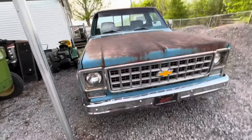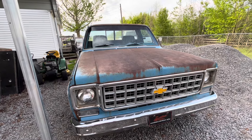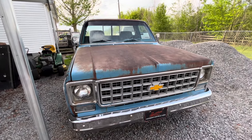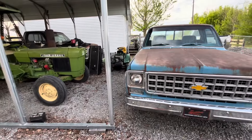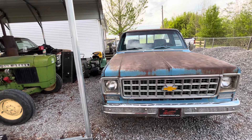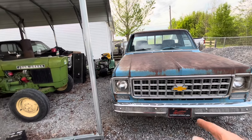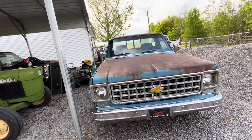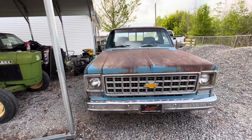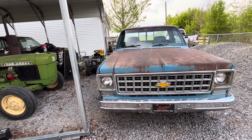It's been a while since we talked about Short Bed Fred. For Christmas my wife got me some roller-tip rocker arms. I put them on, it didn't run right, drove around trying to work out the problem, ended up putting the old rocker arms back on. When I tightened the number four rocker arm down and it made contact with the top of the valve, it started popping back through the air cleaner. Long story short, had a bad valve in the head. Pulled the heads, put another set on — but all my swapping had also eaten a cam lobe.